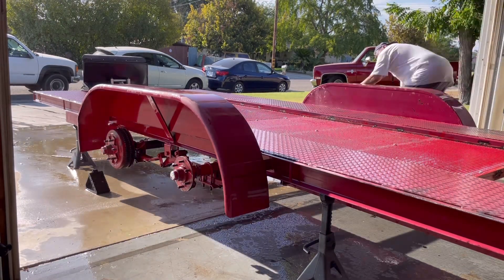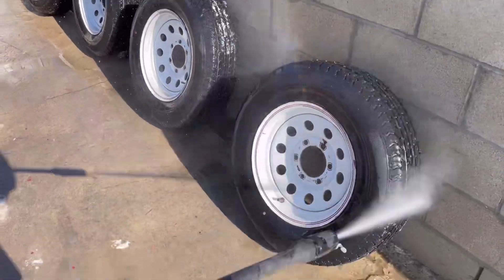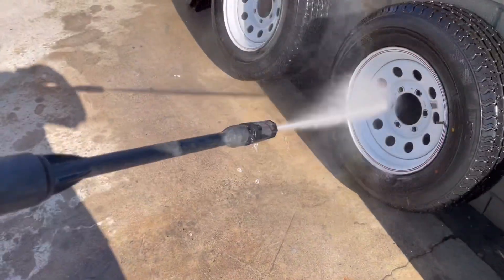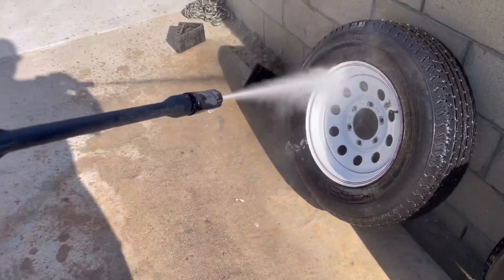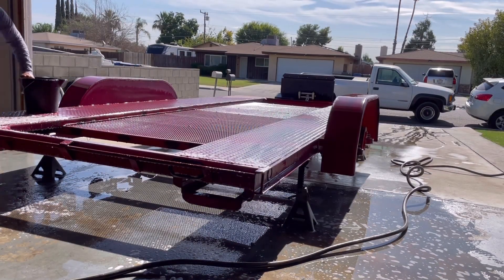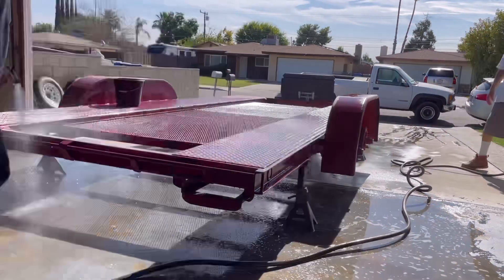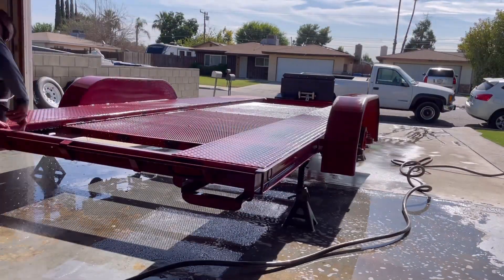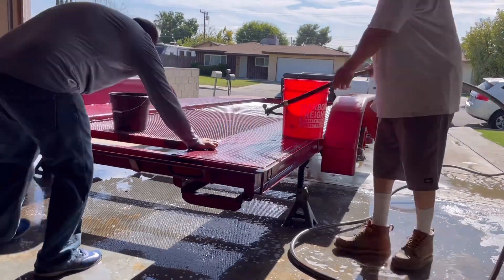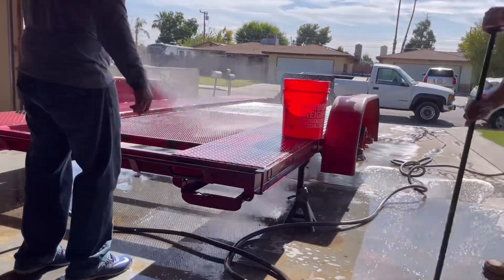Each step it was looking a little better. Throughout the years trailers can get neglected and forgotten about, and tires get aged, so I had to put on new tires — I got them from Amazon. I like the white rims; it's a six-lug and from the factory it has a red and blue pinstripe around the perimeter of the wheel, which I wanted to keep original. There were a lot of contaminants, old oil, and dirt in hidden areas, and all that grease has to be completely removed before repainting, otherwise you'll have problems with paint bubbling and fisheye.